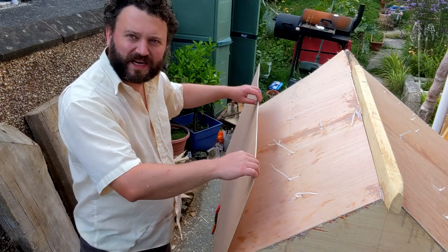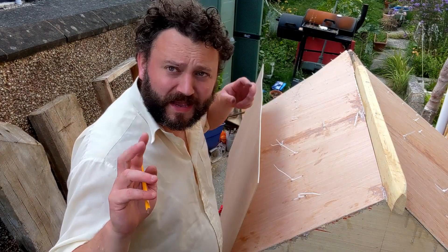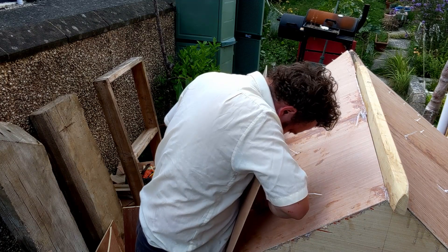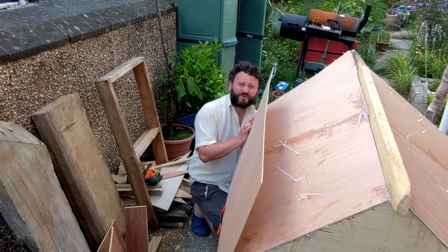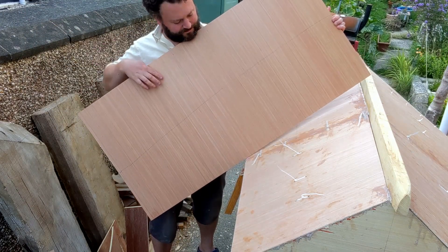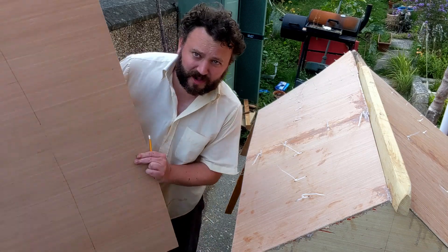I've just clamped up this panel to measure out the freeboard. By measure, I mean draw some lines around the actual thing — it's easier just to offer it up to what exists. I'm applying some of my body weight to the panel to make it conform, and then you've got the outline of the panel that you're going to cut out. Thankfully this board is going to be big enough to put two panels on for the freeboards at either end — they won't be identical to each other so I'll measure them up individually.